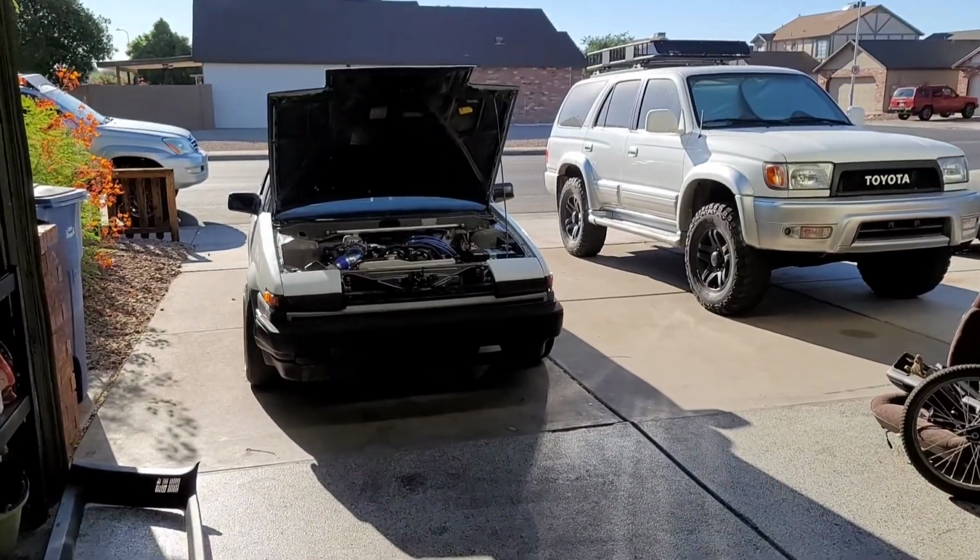It's something random. The only thing I haven't done so far is the fuel system. So fuel injectors are going to be next, and I need a test for fuel pressure. It's running. The problem is it's running rich, and everyone who typically has this problem, it's running lean, and so my plugs are just fouled out. So I feel like maybe the injectors are sticking, or something like that, where they're just dumping too much fuel. I don't know. The injectors seemed pretty clean and pretty nice. They have newer gaskets and new O-rings on them. So anyways, I'm ranting. So, the new project.